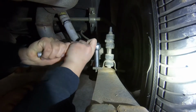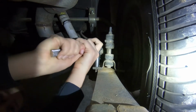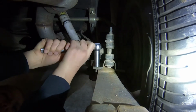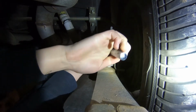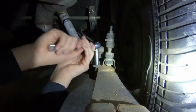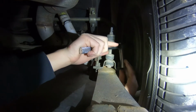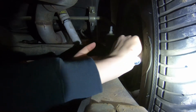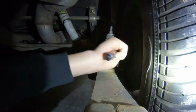Now we're detaching the rear anti-sway bar mounting points. There shouldn't be much pressure on it. I mean, that's always something to think about, but there shouldn't be much pressure on it. Although the suspension's moving a little as she's undoing it. You might want to undo some on one side and then some on the other, and then some on the first side, kind of like that, let it down kind of evenly. That certainly is how you should always tighten up any sort of U-bolt. Try to always keep them even, because if you don't, you'll end up with one side a lot longer than the other.